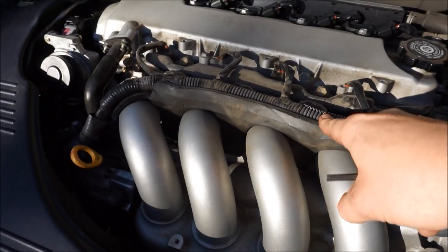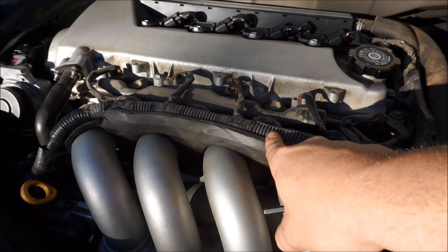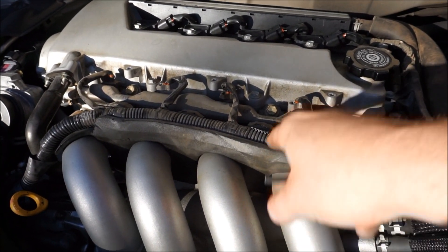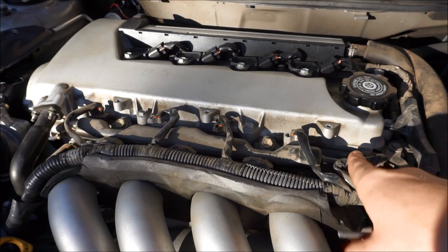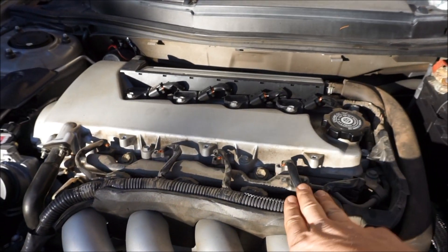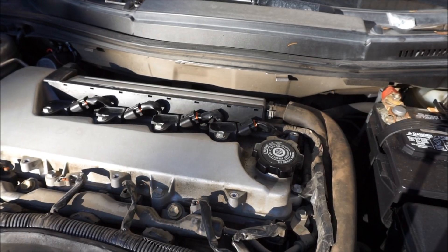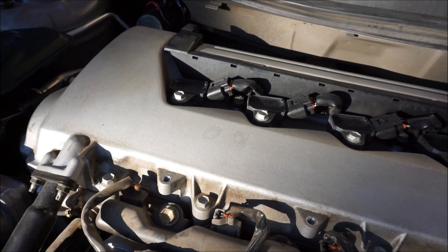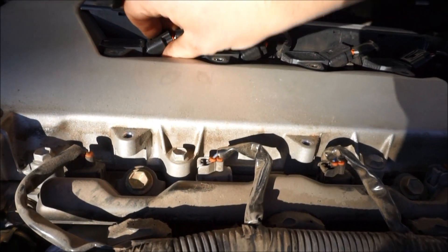This kind of dusty thing is your fuel rail. This wire harness right here comes with a cushy pad — I think that's to keep heat away from where the injectors are. You're gonna have to undo these bolts here. Set aside the allen wrench and grab a 10 millimeter, because the first set of four spark plug coil pack bolts are 10 millimeter — let's do those first.